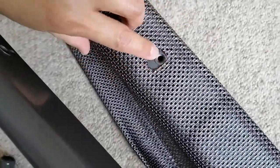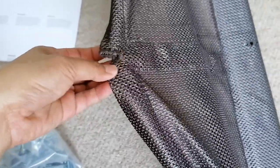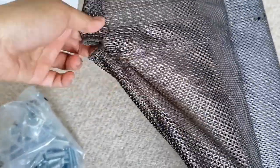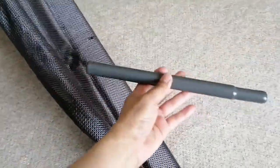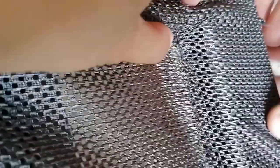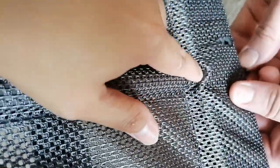There are holes on the mesh that match with the holes on the bar. Once you've got that all in for one side, there's this bit in the middle. You're going to use this one — put it in this way where the bottom is the small bit. That small bit actually goes into the metal — there's a hole that goes right into the metal where you can screw it in.